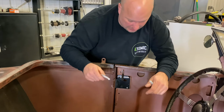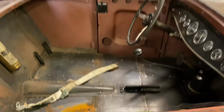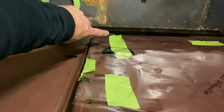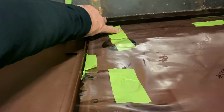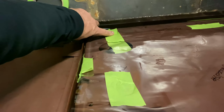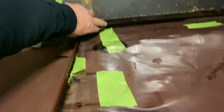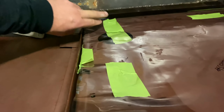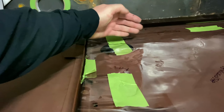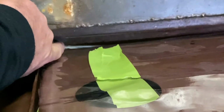One other thing to look at when you're making your door panel, which I'm going to show you on that door panel again. If you're looking at this, you can see down there, you see how there's light down there? You can also see the floor. Some cars, this floor piece actually comes right to the door panel. That's a very critical measurement, because if you make a door panel too thick and this metal's here, it's not going to be able to shut. Now you can see on this one, way down the bottom, I don't know if you can see where my finger is, it actually is a step. It comes down and then back out again. That step is fairly close, but it's not touching the door. It's not going to really be a problem for us.